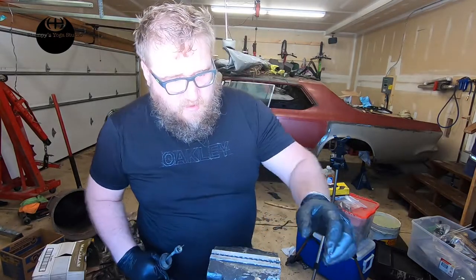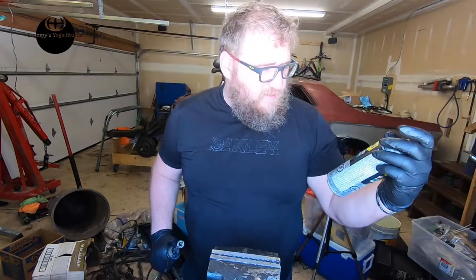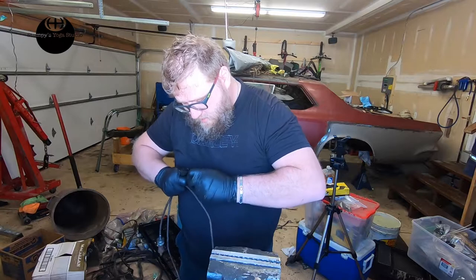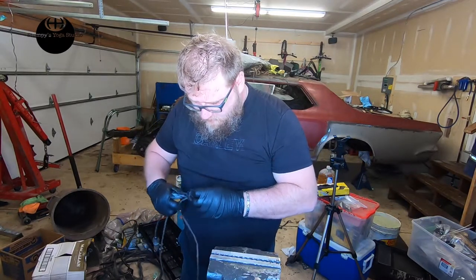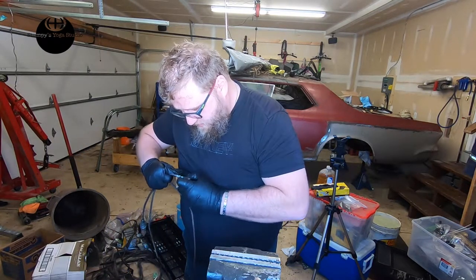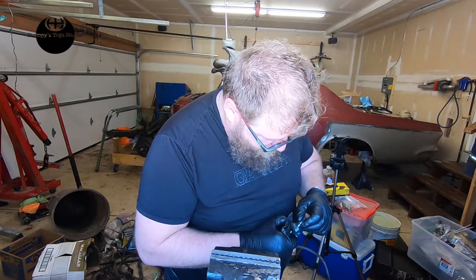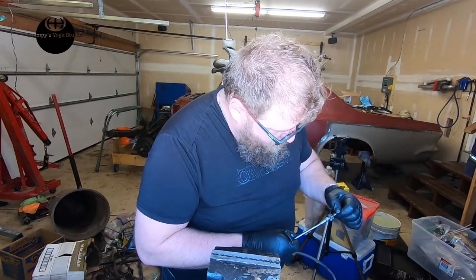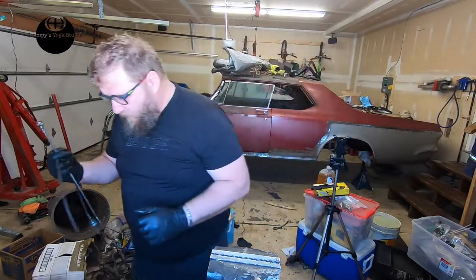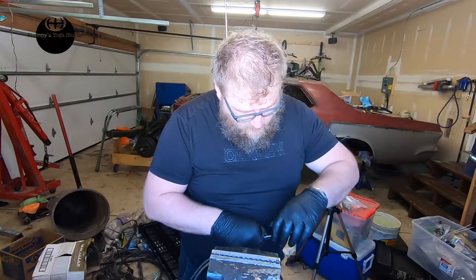If we can, let's just lube it up a bit, okay? This is my go-to now, this white lithium WD-40. Oh yeah. Gotta be careful because these old rubbers break and tear pretty easily. What I might just do, I'm gonna just cut the end off that. Since this one's already broken, we're not gonna use it. All right, this was the broken speedometer cable. Pulled the end off of it. Now we got this grommet.